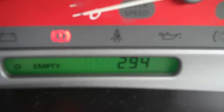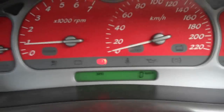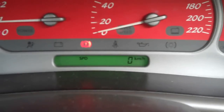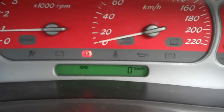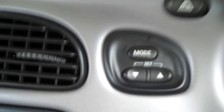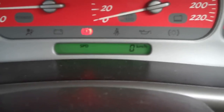But what I want to have on there constantly is the digital speedo. As you can see, it looks pretty cool. It's something that not a lot of people know about, and there are a lot of forums saying that it's a myth. But if you don't go and get a Tech 2 to do it at a Holden dealership, you'll have to do it the way I did — by putting your finger on mode and down at the same time before you turn your ignition on and keep holding it until it shows up with volts.